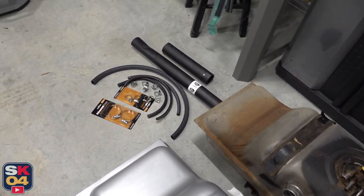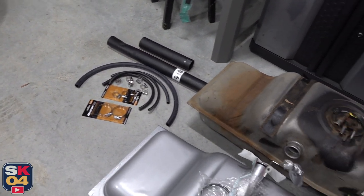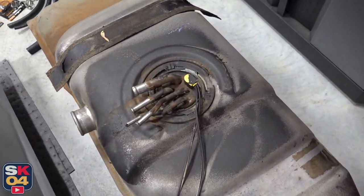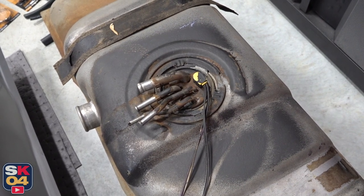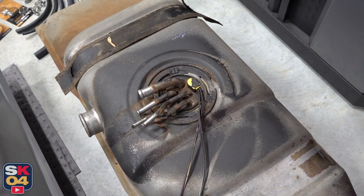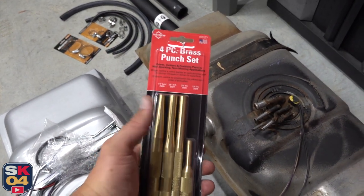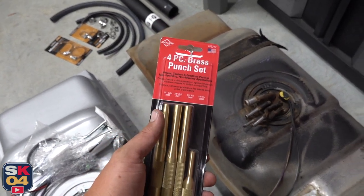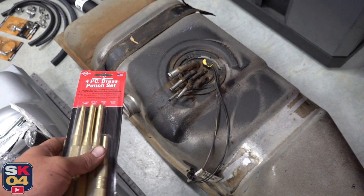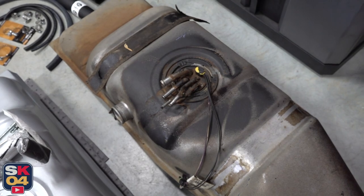There's various length hose — I definitely don't need that much, but I got a little extra for the future. A bunch of new hose clamps. I did want to mention though, if you were just replacing the sending unit, there's a lock ring that holds it in place. When you undo that lock ring, don't use a hammer and a screwdriver — get yourself some brass punches. They're non-marring and they don't spark. You're dealing with fuel here, and if you accidentally make a spark, you could cause a fire. So just be mindful, get yourself some of these, and do it right the first time.